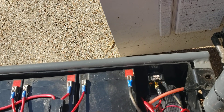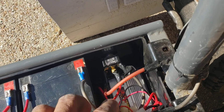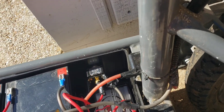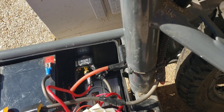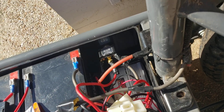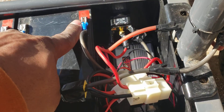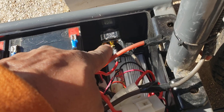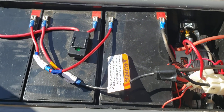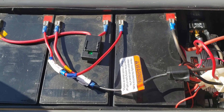If you have any other questions just send me a message. I didn't want to get into the wiring of the new controller for the throttle — just look at these big connections and pay attention to where they come from: the on/off switch and the little one from the charging port. That one big wire that normally goes to the positive terminal is the key to all of this — you're basically just splitting it with a switch. Leave a comment, take care, peace.